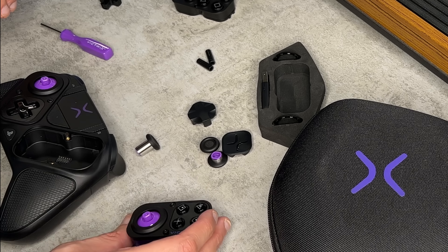Pro tip when installing these modules: go back and forth rather than jacking one screw down completely and then moving on to the other. You will notice they tighten more snug as you go back and forth. Start snug on one side and then alternate until they evenly distribute pressure on the modules to make sure you make good contact.